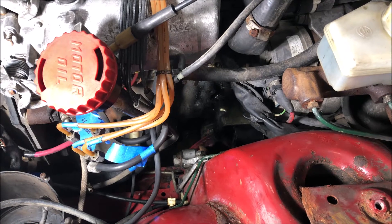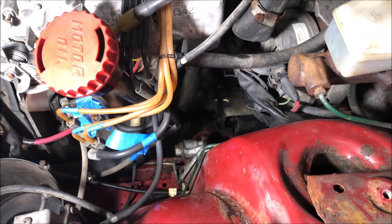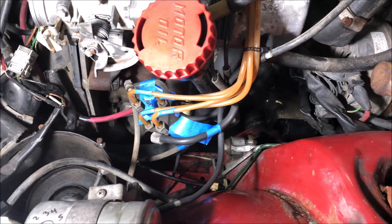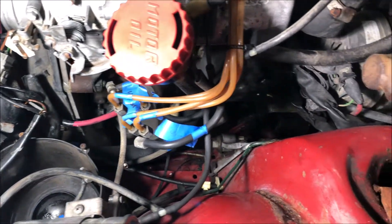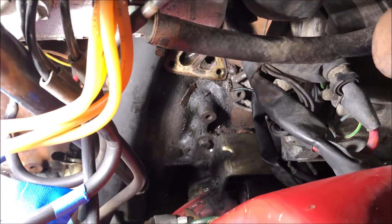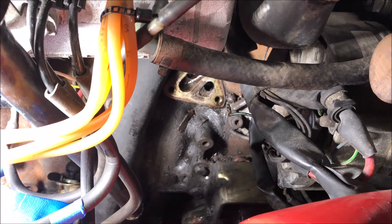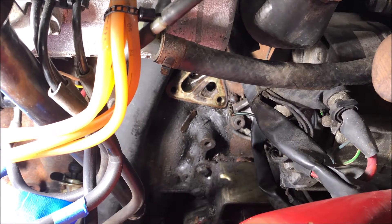This is one of those jobs where the repair is one thing, but getting to what actually needs to be repaired is another thing. If you're not following along with the project, I do have some things out of this car — like the fuel distributor is out right now. On the top side of the engine here, before we go underneath, there are a couple of things you'll need to remove. The oil filter would have to be removed. This car has been sitting for a while, so the filter was pretty well seized on, so I just went ahead and took off the part that the oil filter mounts to. I'll have to get a new gasket for that.